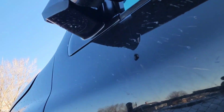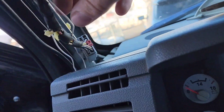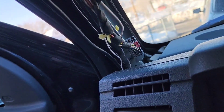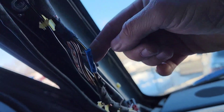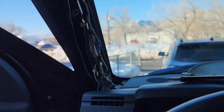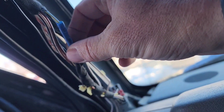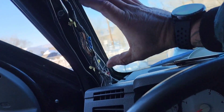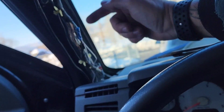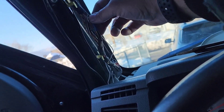And now watch this — ta-da! So here's what we did. I took the white wires from my mirrors and put them up inside that connector. I know a lot of people hate these butt connectors, but I haven't had any problems with them so I'm going to keep using them. That's all you've got to do: find the yellow and baby blue wire, or number 9 in your plug, find a good location where you have a little room to work, make the cut, put the connector on, and bring the wires up. I've got all three of the wires connected at the bottom.